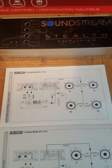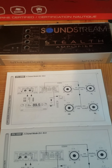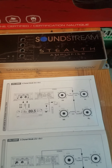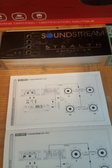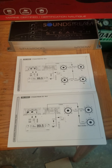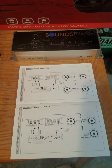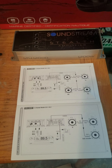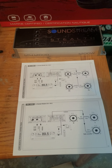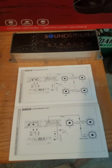Lo and behold, the easy ones in the back are 5.25. So I ended up getting the Polk coaxial speakers — the DB522 for the back, and then the matching 6.5-inch for the front. That's what it turned out to be — perfect fit, both sets of speakers. I had to bore out lightly with a drill bit; it was plastic, super easy. Just go slow, get the factory bolts back in, and they fit perfect.